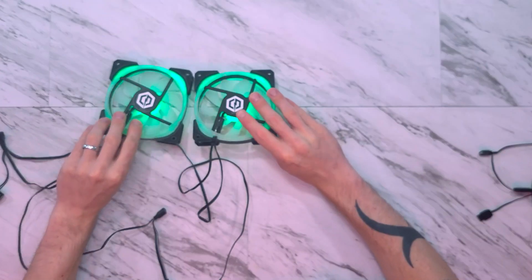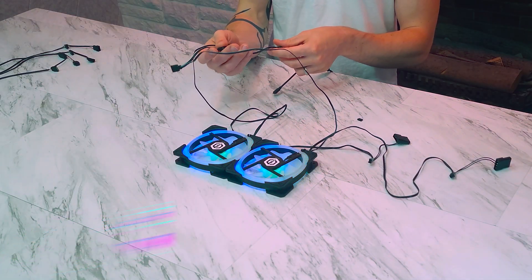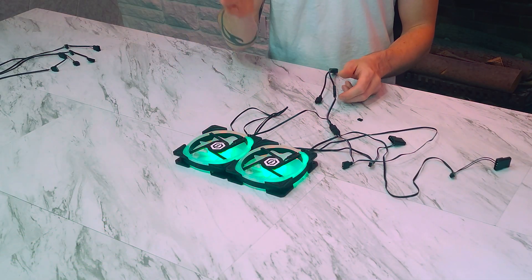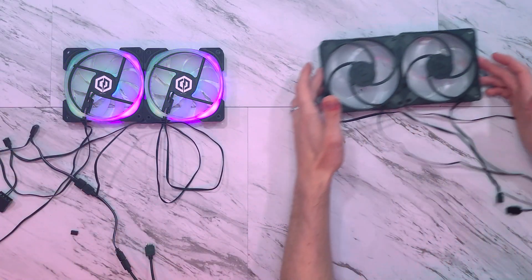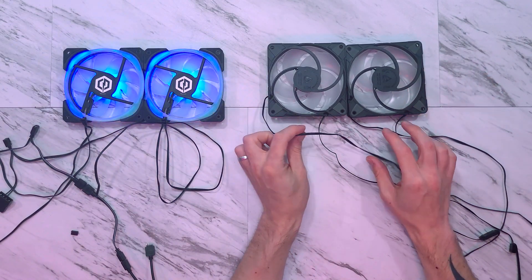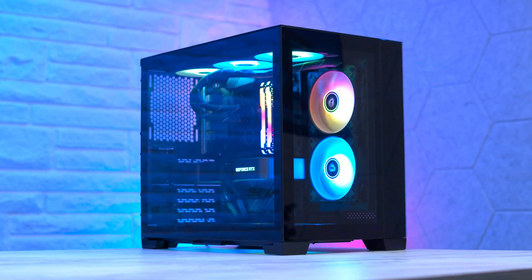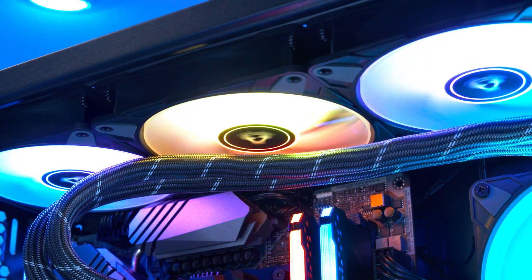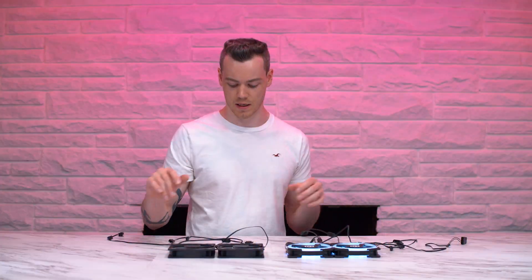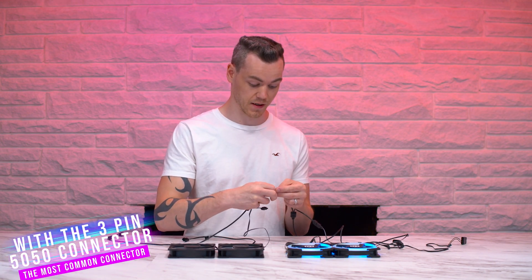Now these CyberPower fans — I can't actually find much information online about them, so they may not necessarily state daisy chain solution. But as you can see, they're connected to one another and they're displaying the same colour on every LED for both fans simultaneously. Now the way to do it properly is this: these are the Arctic P12 ARGBs. I first used these fans on my gaming system, and then I got a ton more for my editing system. The thing I noticed is that they implement a proper daisy chain with the 5V 3-pin header. I'll show you how that works now — this is not sponsored by Arctic. It's just that they're the only ones I know that have actually done this, which is kind of baffling.